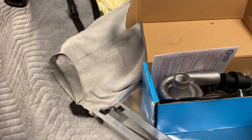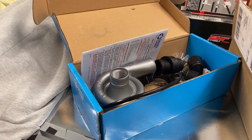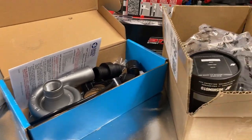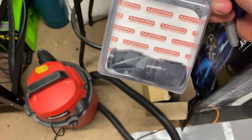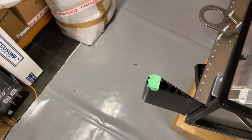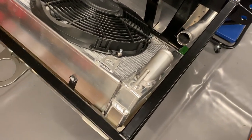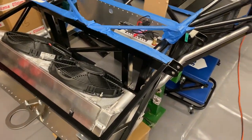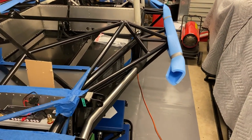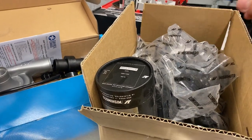Even the EWP150 rating of 2.5 litres a second is probably nonsense — that pump's rated at a free flow rate with absolutely no head on it, so you're probably down to around 2 litres a second once it's in the system. I'm also not going to be running AN lines for my coolant setup — I was going to because it's really neat and you can get dash-16 lines big enough for coolant hoses. But the downside is that braided hose really transfers vibration and is super inflexible, so as much as it looks great in show cars, I'm not going to go for it on this car. I did buy some black hose clamps which will look quite nice.